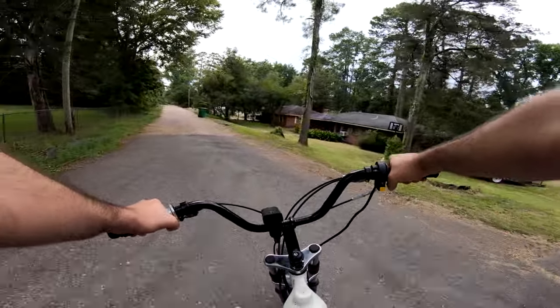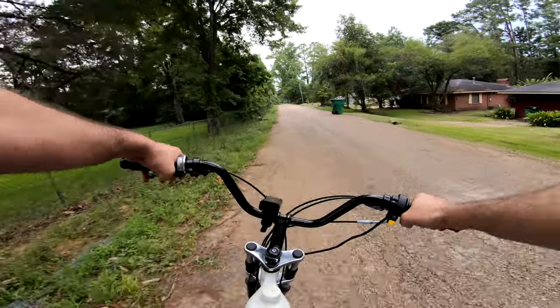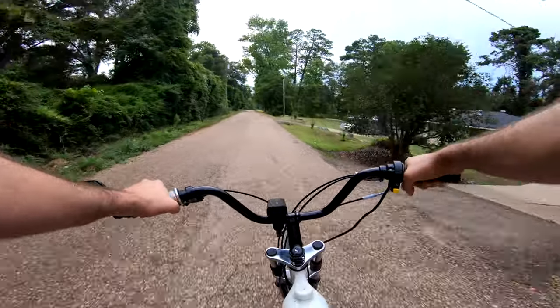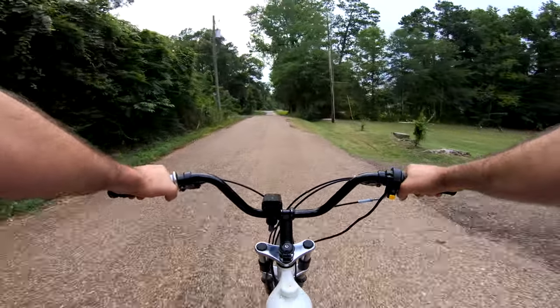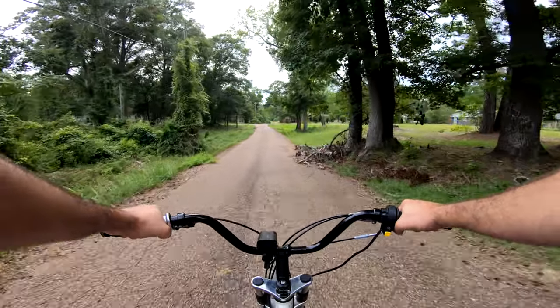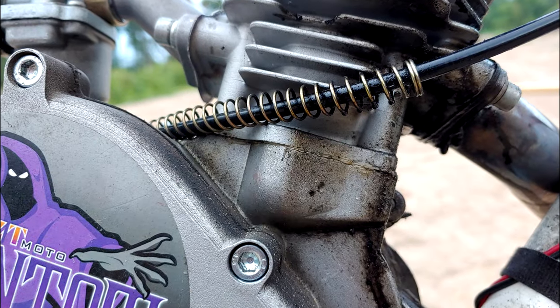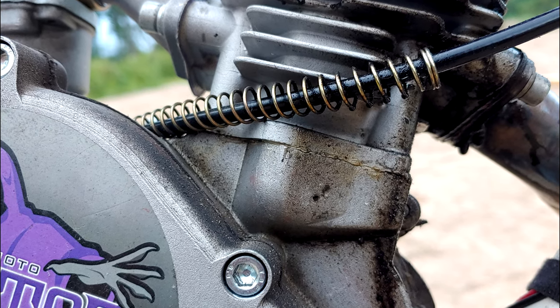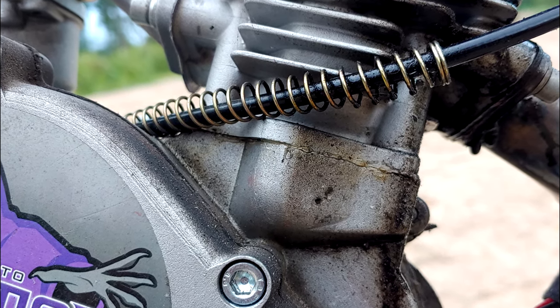The version of the motor that you see in this video is number 3, where it came with a needle bearing. With that being said, for the third generation, or version, which is what we see in the video here, it's pretty much a plug-and-play swap. And the only thing I really had to do was remove the base gaskets so I could get the proper squish gap. We're using ultra-gray sealant instead of a base gasket.